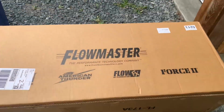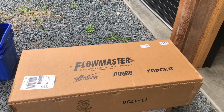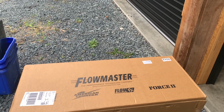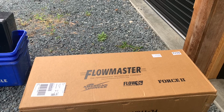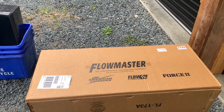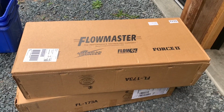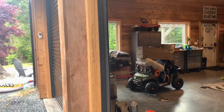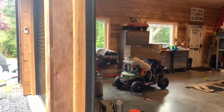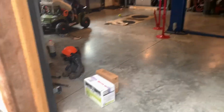This is just a universal kit, 2.5 inch. That is a 454, but it doesn't really have any mods or anything. It might have a cam, but even then it might be an RV cam. But yeah, it'll sound great. It doesn't need 3 inch really. And these are really simple. This is what I used to do my exhaust, but mine's 3 inch, knowing that I was putting a much more healthy engine on that eventually. And that's all the clamps and stuff. So anyway, I'm gonna get started.